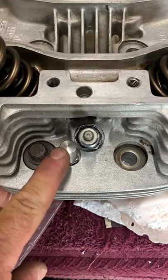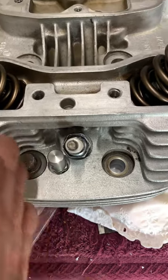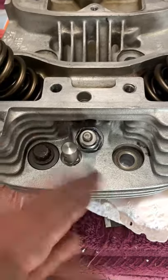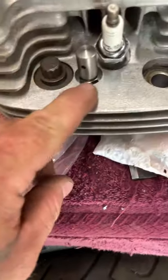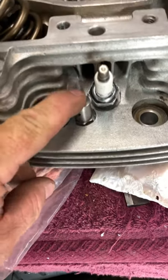If you're going to use these, he's going to have to just grind that socket off flat on this one side, round it off a little bit, and just keep it for the bike — or just get a set of Kibble Whites. They come up about where that hole is, and then obviously you won't have any problem.